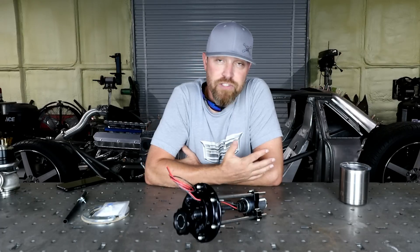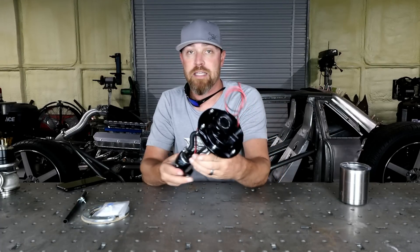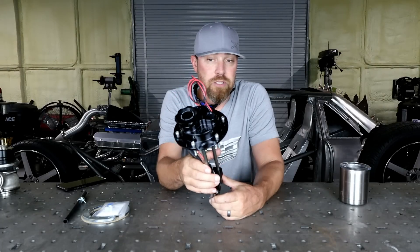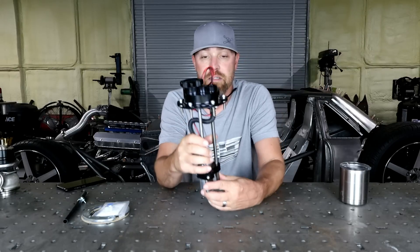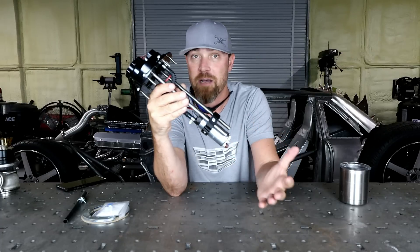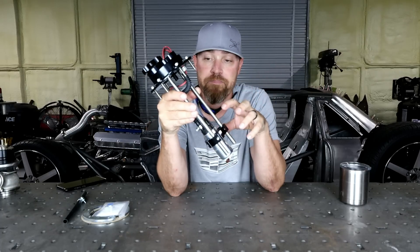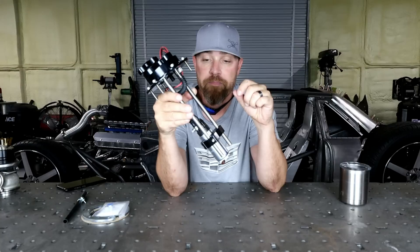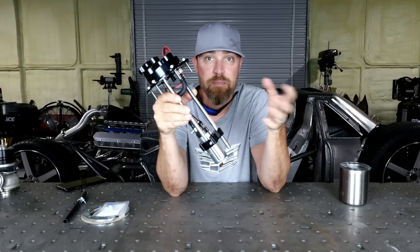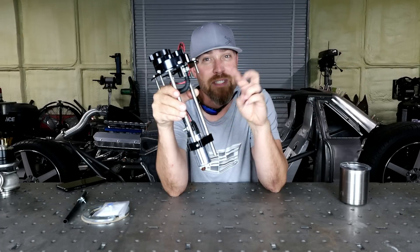Well, things have changed over the years — actually just here recently. Technology in fuel pumps has come a long ways. One of those is basically what Holley is offering now. They have several of these. This is their fuel cell EFI kit. It's basically just a drop-in kit — it goes right into any fuel cell. It has a little bracket at the bottom you can adjust, so this fuel pump itself can have a different depth to it depending on how big your fuel cell or fuel tank is. This particular setup is kind of an adapter to convert a fuel cell or any fuel tank — if you had a carbureted setup with an external fuel pump, you could convert that fuel tank into EFI with a drop-in factory style fuel pump.